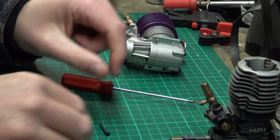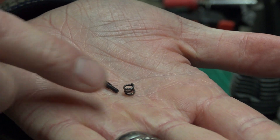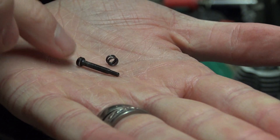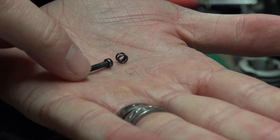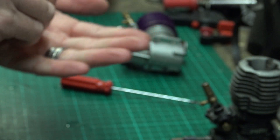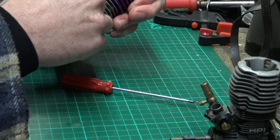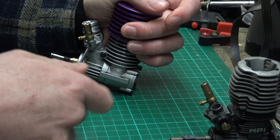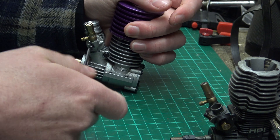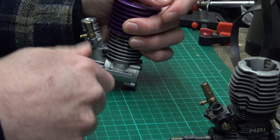So there's our spring and there's our screw. You'll have to excuse my cracked hands because I've been doing a lot of work recently and the hands are getting a bit dry and cracked — all the sanitiser and all that. So now you know what the tick-over screw looks like, and you know that it's not a needle and it doesn't affect the tuning in any way. There are people out there who are still going to say 'oh it does' — 'when I tuned my engine I turned the tick-over screw and it got faster.' It's all in your head, I'm afraid. Because it doesn't — it's impossible.